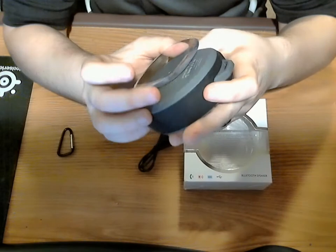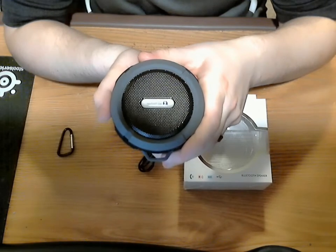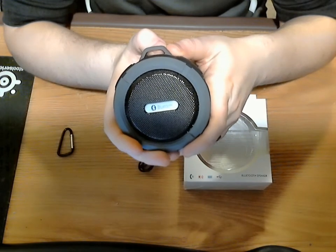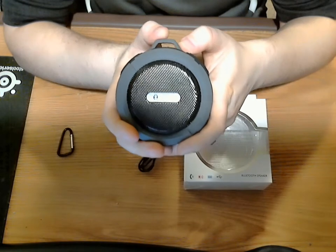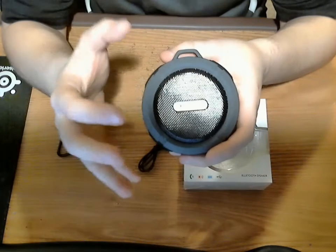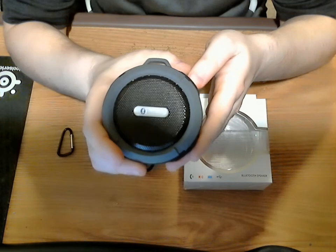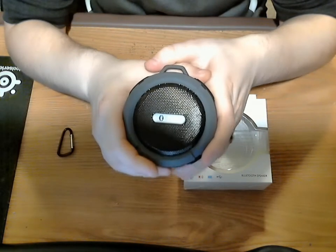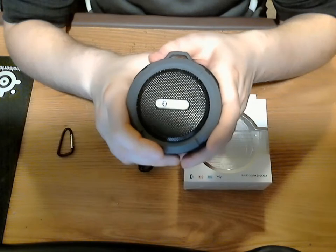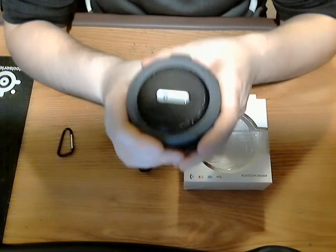I like it so far. Though this is listed as a waterproof speaker, it's not entirely waterproof. It's rated at IP56, and the 6 is actually your waterproof rating. On the 6, at least on this one, it's more for jets of water being splashed at it or waves if you're crossing through a stream or something like that. I definitely would not submerge this in water — it's not rated for that. So don't go throw it in your pool or throw it in a lake and go diving for it. You're going to probably end up with a dead speaker if you do that, so just know that before you buy it.